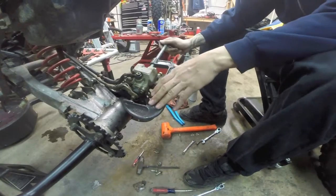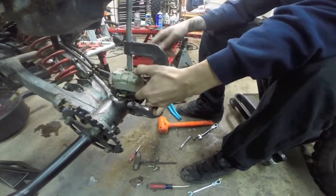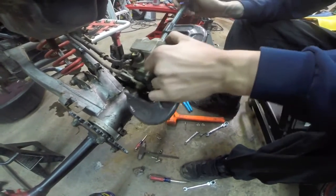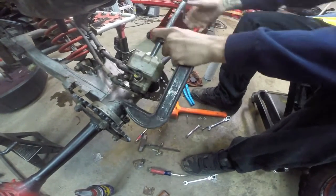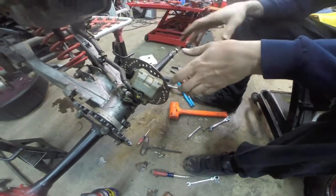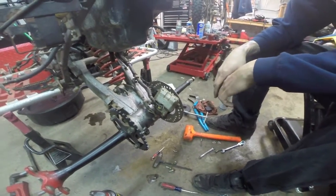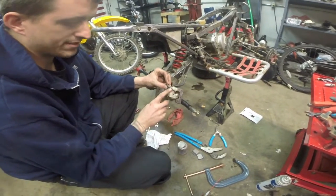This is where we're going to use our C-clamp. We're going to clamp between the head of this bolt — be very careful not to mess this bolt up. You're going to put the other end of the clamp on the actual piston of your caliper and crank them in. Ours actually hasn't had fluid in it for a while, so the piston is actually fully retracted. If your quad has twin piston brakes, you have to use one of the old pads in there so you actually draw the pistons in together. Now that we have that done, we're going to install our new pads. Now that we have our caliper retracted all the way, we're going to take our mounting pins that the pads ride on.